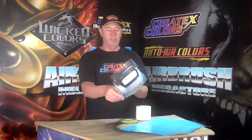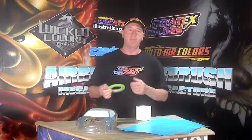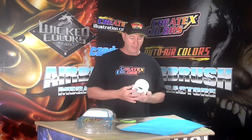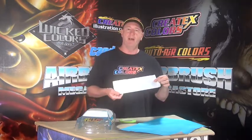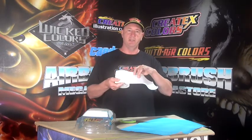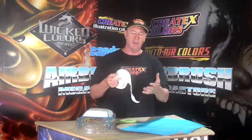So now let's talk about masking. As you can see, there's a blue film and then there's the paper mask. For masking up designs I use the 3M Green Automotive Masking Tape — really clean, super good lines. Now as far as the paper adhesive, this is AutoMask — all this is on the website. This is a masking film: paper on one side and a low tack adhesive on the other. You can use it to mask up areas that you don't want paint to get onto when painting out a graphic.